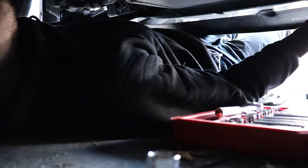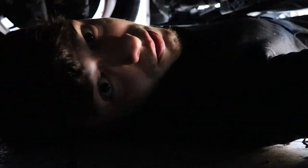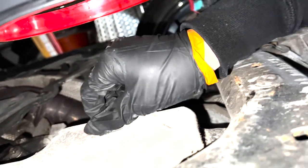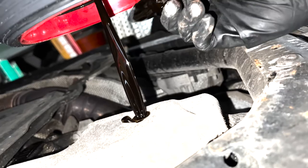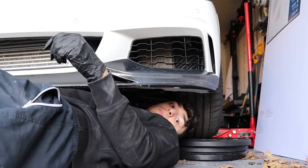Now that we're under here, there's not a lot of space so I'm using my phone as a light. We're looking at a 17-millimeter drain bolt — you can kind of see it right there. It does look a little expired and there's no washer on it currently. Here comes the money shot — loosening the drain bolt and boom, we're draining. Let's get out from under there.